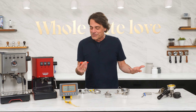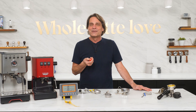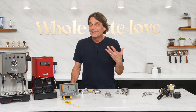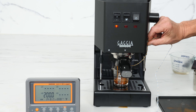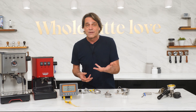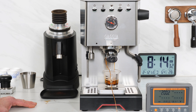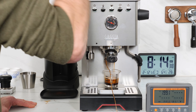So what have I learned? JB's UV Cure Super Weld is really super awesome — my probes are still rock solid after months of use and boiling during calibration, really a lot more robust than I anticipated. In terms of machines, some handle temps way better than others. I've learned how to get steady temps from traditional single boilers like the Gaggia Classic Pro E24, how flush routines and idle times impact temperature on machines with heat exchange boilers, and how machines like the new Gaggia Classic GT — a dual boiler — stay very consistent through seven back-to-back shots at two and a half minute intervals. If you'd like to check out that performance, I've linked the video down below.